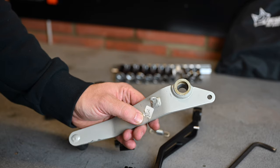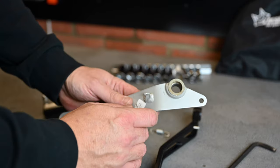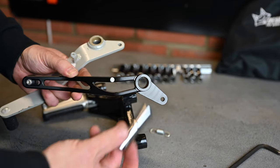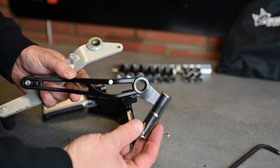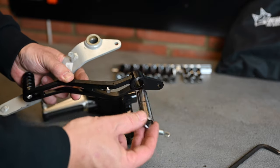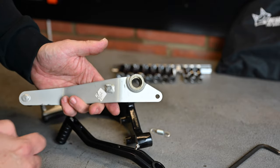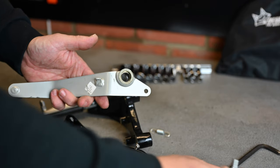There is another step. Inside here is a small sleeve — these don't come with that sleeve in the kit, or at least mine didn't. So it's just a case of getting this one out. The easiest solution for me was to find a socket — in this case one of my long reach thin wall 11mm sockets that fits perfectly into that hole — and then drift it out with a hammer, then pop this back in there, remembering to grease this pin before putting it all back together.